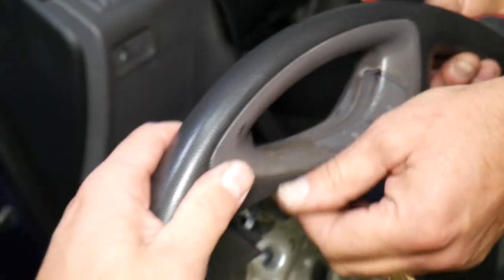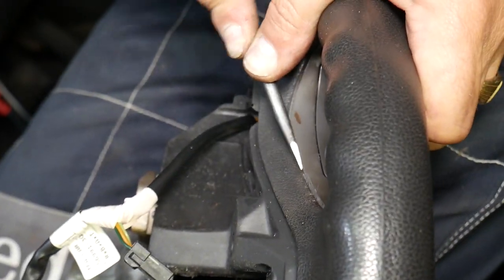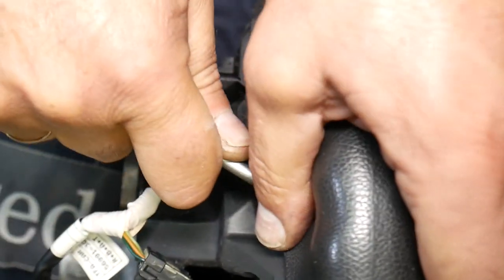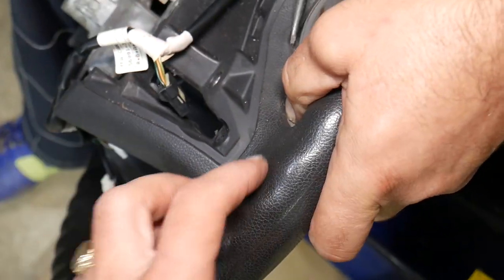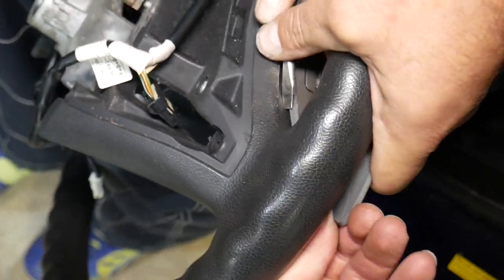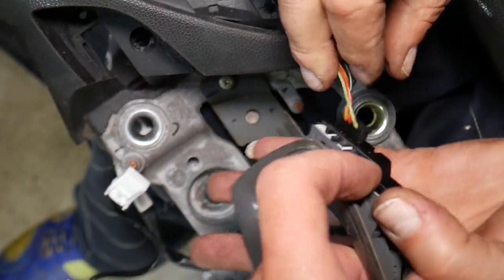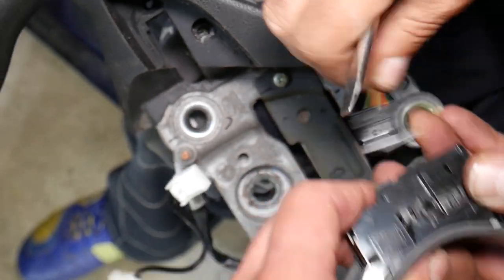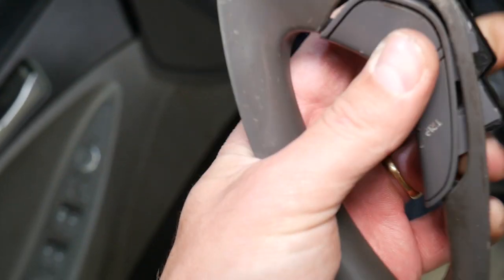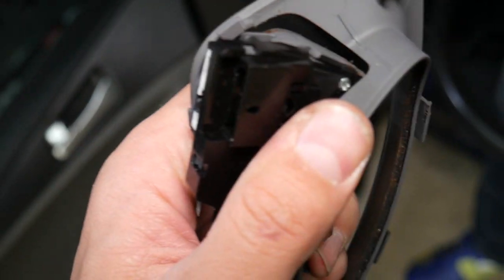That's why you should watch until the end — so you don't mess it up. Once you remove the screw, you need to separate the trim piece from the steering wheel. There are multiple clips, so a pry tool works better than a screwdriver. This is a parts car so we're being a little lazy, but just push it down and it pops out. That's your switch right there. Disconnect the connector — there's a little tab, just pull on it. At that point, if you need to replace the switch, you can see it comes with the housing. Pull it out at an angle. Thanks for watching and see you guys next time.